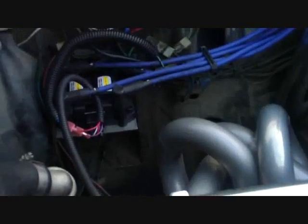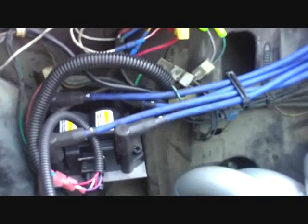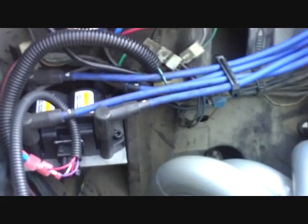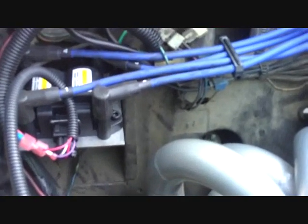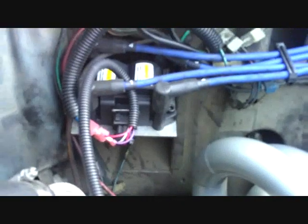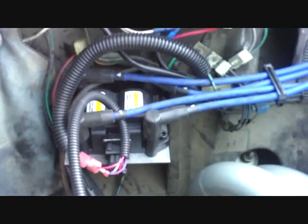It's very simple to time once you get that installed. You connect the harness from here over to the coil pack unit. The coil pack mounts in place of the original coil over the two studs on the fender well. You connect your battery and tach wires here to the unit and route your spark plug wires.